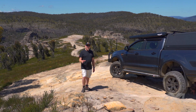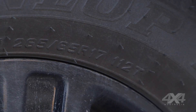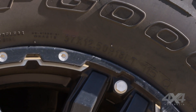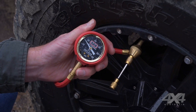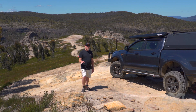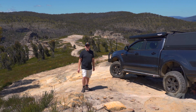The first thing you want to know about your vehicle is what kind of tyres you have fitted. If you have standard passenger car tyres, they're likely to get damaged on a track like this. But if you equip your vehicle with light truck construction tyres, they're going to resist puncturing and tearing a lot better in this terrain. As always when driving off-road, focus on your tyre pressures. We've been running 35 psi on the way up, dropped to 25 psi on gravel roads, and 25 psi should work well on this descent. If conditions look slippery, you might want to drop them a bit lower.